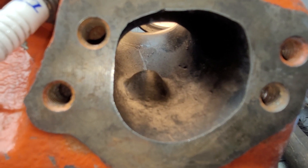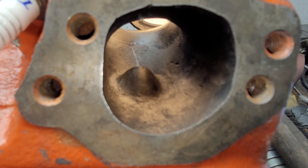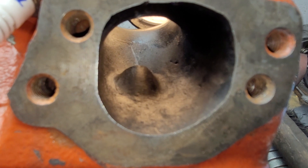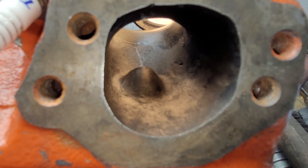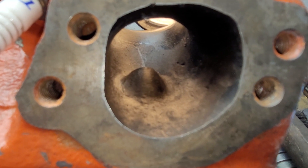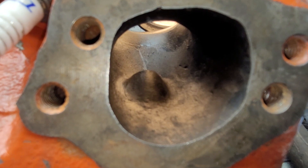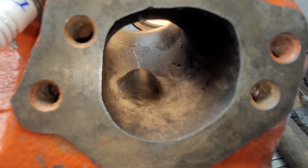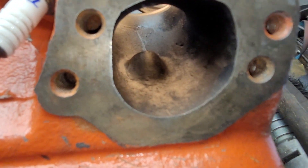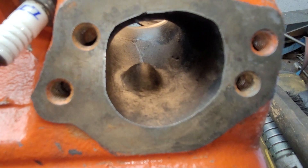I did a little looking up on these - you can find some info on the internet but couldn't really find a lot of flow info. A couple guys said they ported them up to 300 CFM, and I believe that. These look a little bit like that set of iron Trick Flow heads I think I still have - big rectangular intake and what basically looked like a big E7 exhaust that didn't move a huge amount of air through the exhaust. But guys would make a lot of power with them - they'd hit it with a lot of nitrous.